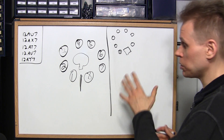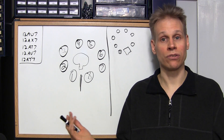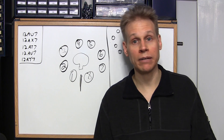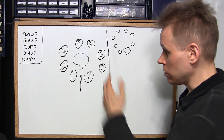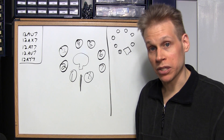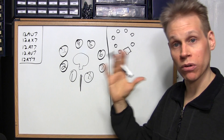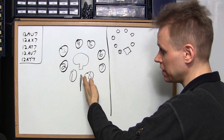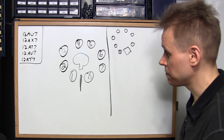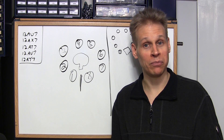So let's talk about the basing diagram on a standard octal tube like a 6L6 or 6SN7. When you look at the bottom side of the chassis you'll notice that there's a bunch of pins sticking out of the bottom of the tube socket, and that's the exact way that it's shown on the data sheet. They always show it from the bottom side, and in order to count the pins correctly you always start at the left side of the index and count clockwise. One thing that the electronics industry has made rather simple.